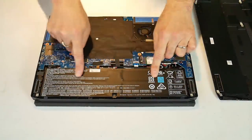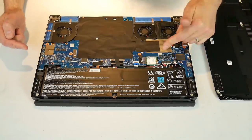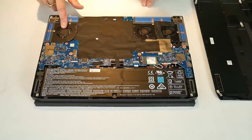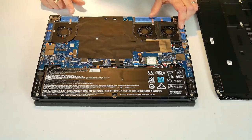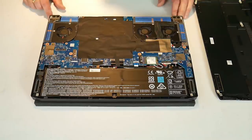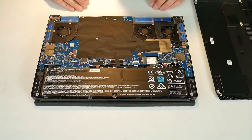Much of the front edge is taken up with the 84Wh battery. Here are the two speakers and the Intel 9560 WiFi card. There are two fans for the GPU and one for the CPU, and four blue anodised heatsinks — though I wish they were larger for the CPU. The rest of the components are actually below the motherboard, and I honestly don't know what the benefit of having an inverted motherboard is — from a design standpoint it is the same as the MSI GS65 and I don't like it.